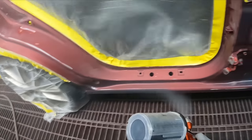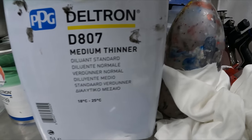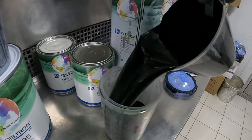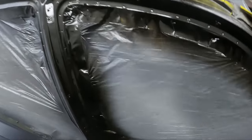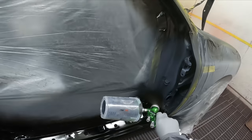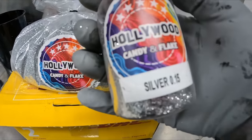Most of this car got painted with PPG — that's just what I was using at the shop. As you can see, D789 is the base coat black and we're putting D807, which is a one-to-one mix. I actually quite like the PPG solvent-based range — it sprays nice and it's user friendly, much more so than the PPG water-based. It's a nice strong black, probably more on the bluer side, which is what you want — a true black. I just smashed a couple of coats down until we got coverage.